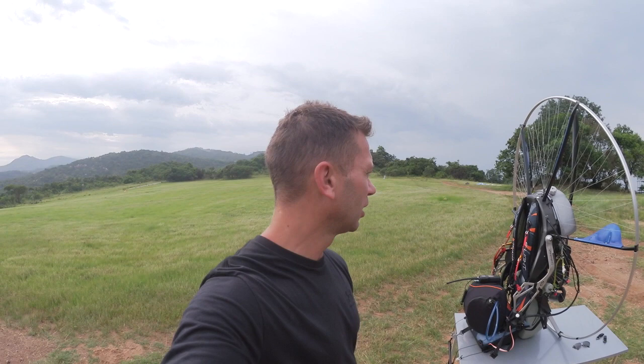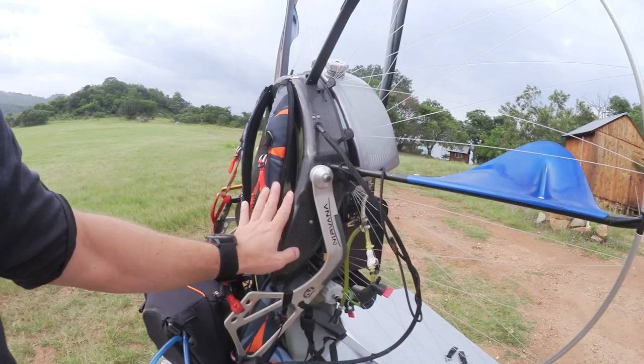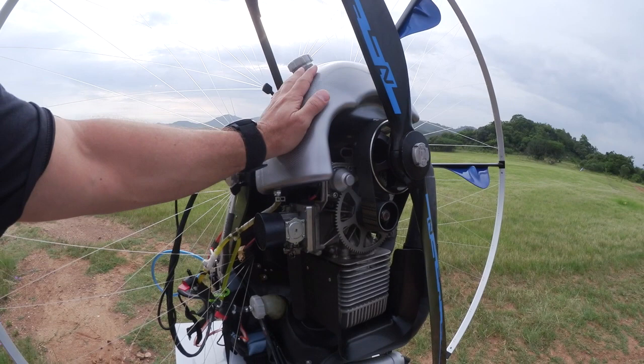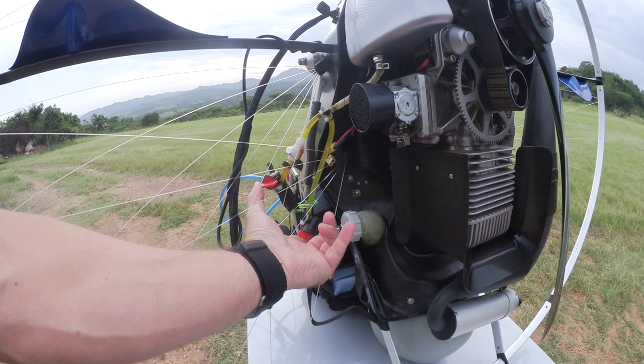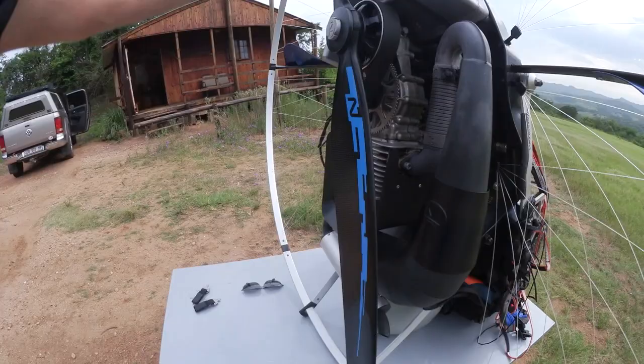Today I'm going to be showing you the final version of the F200 long range cross-country racer. We're going to come up with some acronym to describe it because it is a bit different from the normal one you'd be buying for lightweight mobility and travel. You'll be recognizing the F-light, the typical one I've always been flying with the gravity feed tank at the top. This was the big development Nirvana had to complete — a gravity feed tank of about six liters at the top and 10 liters at the bottom. I have a valve system I made which is different from the one you're going to get from Nirvana, as all their fuel lines are integrated and flow through the skeleton.